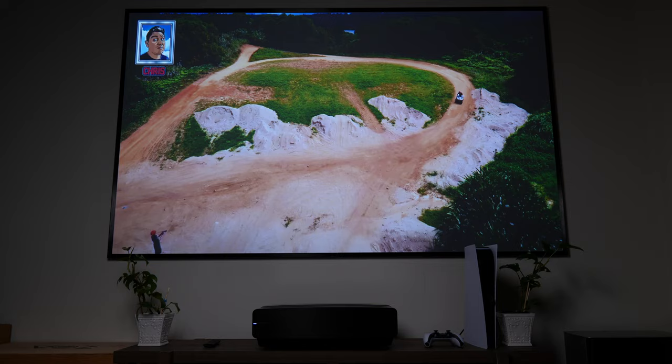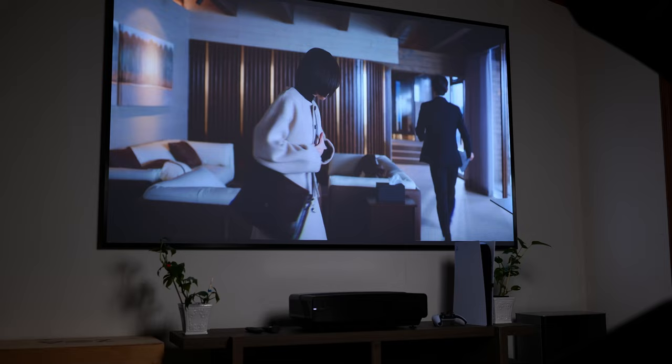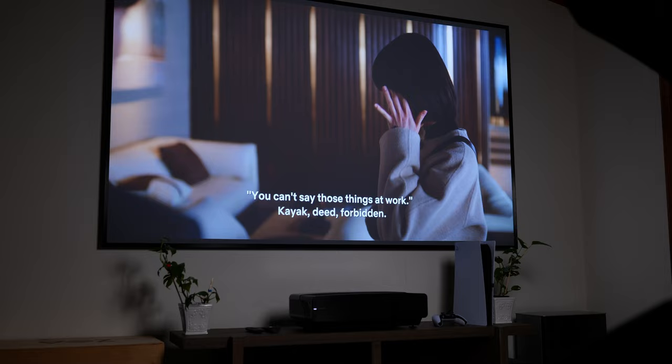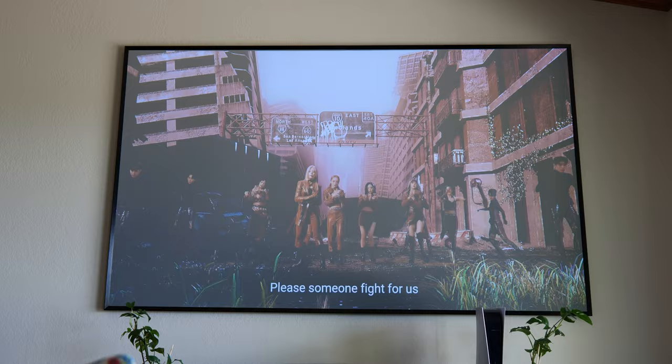After all that setup, it's time to enjoy. The L5G uses Hisense's X-Fusion Laser Engine, which is a blue light source instead of an RGB source like some of their Trichroma projectors. The image exceeds the Rec. 709 standard and meets 83% of the DCI-P3 color gamut. With a powerful light source at 2700 lumens, I found viewing it even with a large window right next to it quite comfortable. It's still most ideal in lower light situations, but since the blue light source does all the work by itself, you might notice some darker areas have a slight blue hue compared to an RGB source where all colors are rendered separately and on demand.